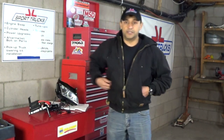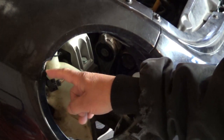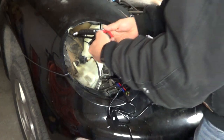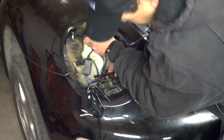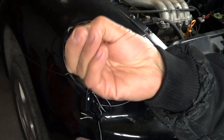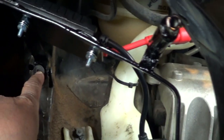With that said, let's get started and see how these lights look. The only extra modification that was made was a C-notch right here to clear the third bolt that fastens the light to the bracket. My bracket slides in from the front very easily — just like it was meant for it, because it was custom made. To hold it in place, I'm using the stock screws that were holding the old bracket. My custom bracket is held by this bolt right here and another one right over here, attached to the body so it's not going to move.